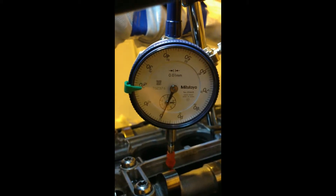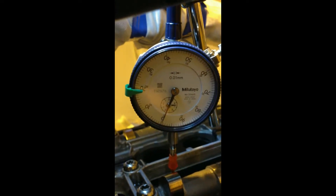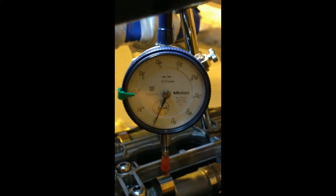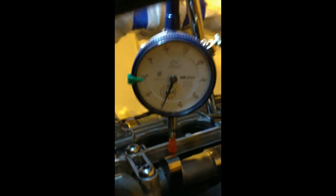What it should do is go around the dial twice to get two millimetres, and then back around to — I know it says 20 there but it has 80 in small text — because that's the direction the needle is travelling in this case, because I'm measuring down, not up.